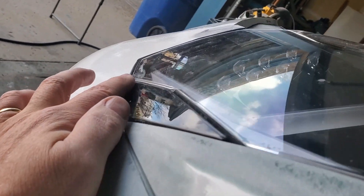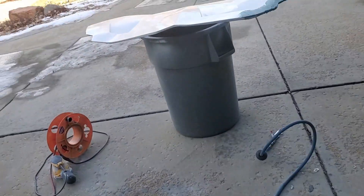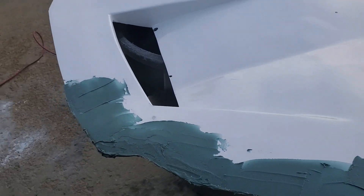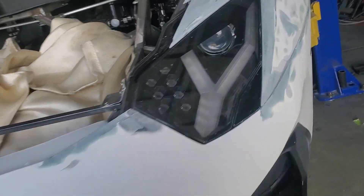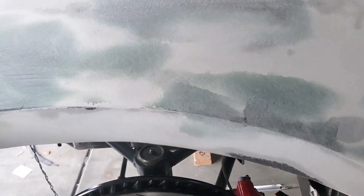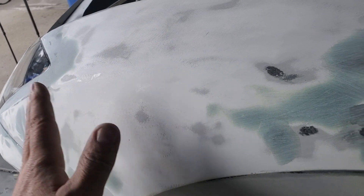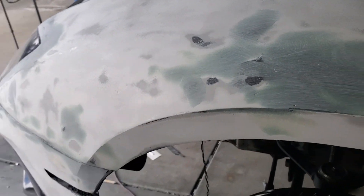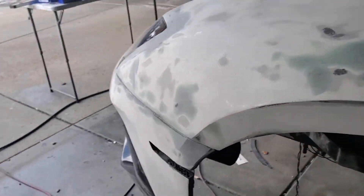I've pulled off the hood, which is over here where I've been reinforcing with carbon fiber and dura glass to get those edges so I can match them up. As I sand and make these changes, some of the carbon fiber is showing through, so I'll try to get a skim coat over the top so that doesn't transmit through any paint. Some panels also had little bubbles where the carbon fiber didn't adhere properly to the plastic, so I've injected epoxy in there and clamped it to get those to settle down — we don't want those flapping around once all the panels are sanded down nice and clean.